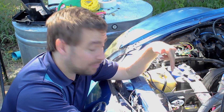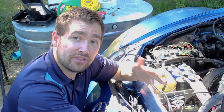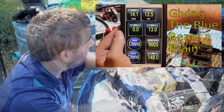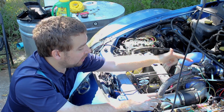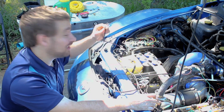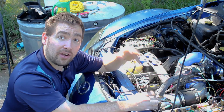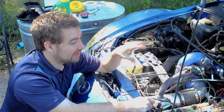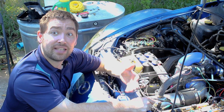In order to do that with my system, I have to have an ignition coil driver. This is an off-the-shelf driver that I just bought, and they're all going to get fed from the brain of the blue beast. The test setup I have right now is just a single spark plug connected to a single coil, which is about to be connected to the brain. This way I can tell if one coil is firing — specifically the front housing leading coil — without disconnecting the leading coil that's running the engine.